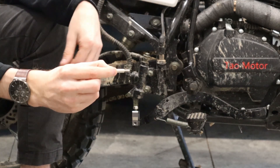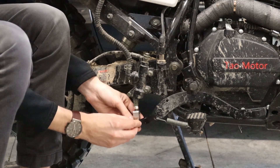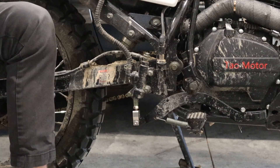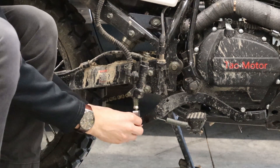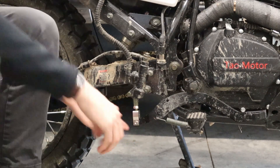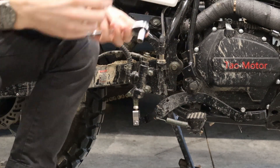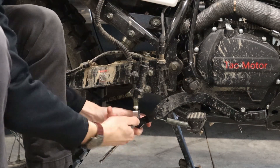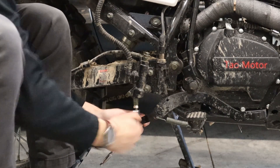Adjust your clevis until the holes get pretty close to lining up. Then take the shoulder screw — I like putting the head side on the outside of the bike because it looks a little prettier than the nut. Line up the hole and push it all the way through. Then take your nylon locking flange nut and thread it onto the backside by hand just to get it started. Once it starts engaging the nylock, it'll tighten up, and that's when you need to grab your preferred tools. I'm using the eight millimeter socket on a ratchet and a three millimeter hex key.